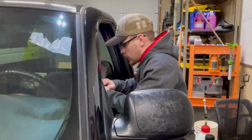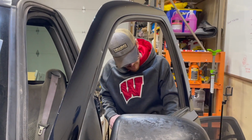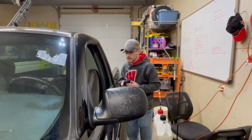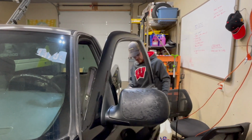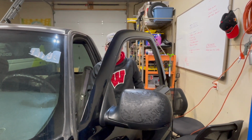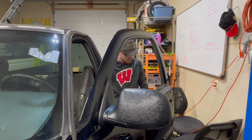It could be a bad door switch on the bottom here, because on your truck with the door shut, you get in your truck, you take your key out. In theory, when you open the door, there's a module down here that'll basically tell your BCM that you're no longer in the truck, and I think this might be bad and not sending a signal to the BCM.